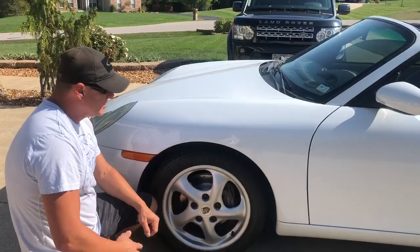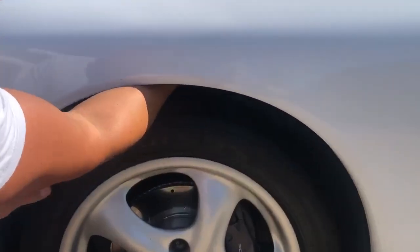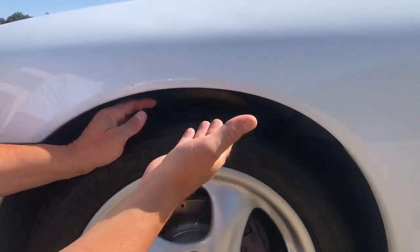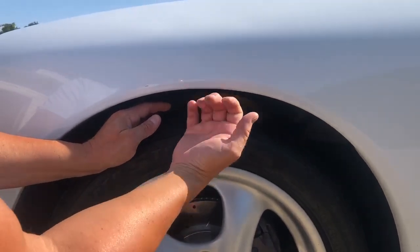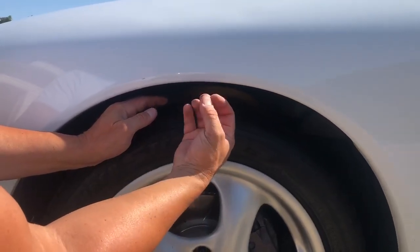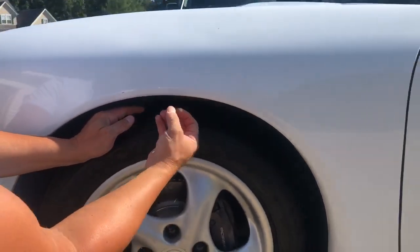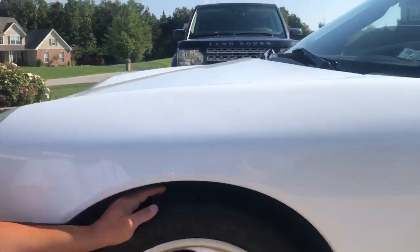If you want to zoom in here — this plastic that's up in the wheel well, you have your coil spring and then there's a plastic that lines the whole wheel well. Up in the top behind here, reach your hand in to get to the edge, pry that plastic down, and you'll be able to feel that cable with your fingertips. Try to pull it back so you can get a grip on it, pull it back towards the driver's seat, and it'll disengage the trunk latch.